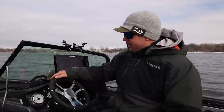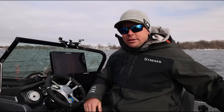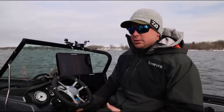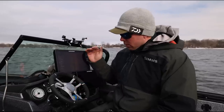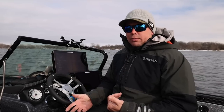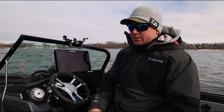We made a custom fit for the gauge right here in the dash so I can always see it at eye level — I don't have to look around for red or yellow tape behind me in the boat. We've got the trim tabs again, an absolute must-have for running big water. Trim tabs help you control your bow. I generally run those all the way down to bury the bow so you're not getting all that bow slap, because this 219 has such a big front deck, and in rough water that can hurt your ride.